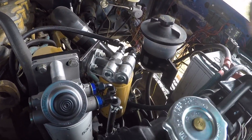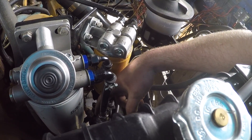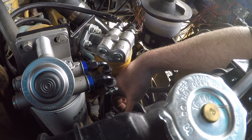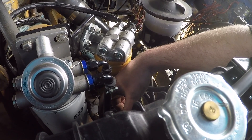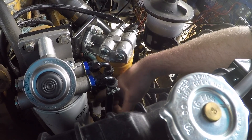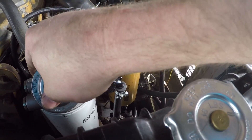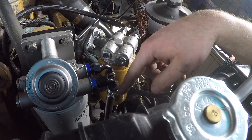I'm still having air and fuel issues. I put that check valve in and actually ran it out of fuel — had about 10 gallons in there but on the hill it couldn't get to it all. I put more fuel in and the next time it started right up — I thought the check valve was working. But then the other day the check valve may have been stuck open, it had drained all the way back to the tank, and when you pumped on it there was just air — no fuel at all. I'm still having an issue somewhere.